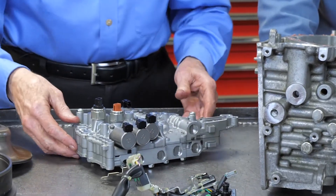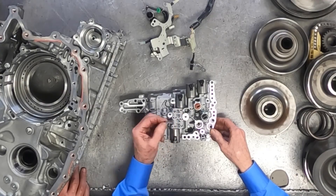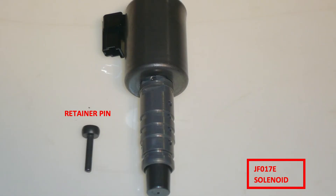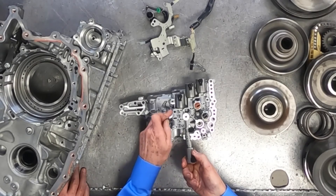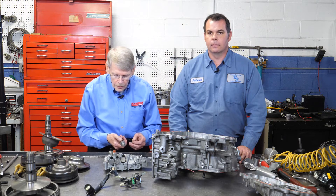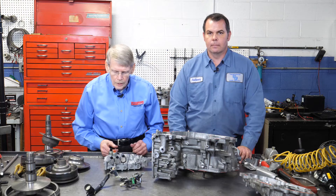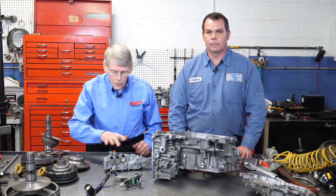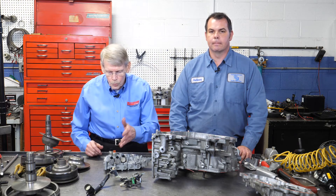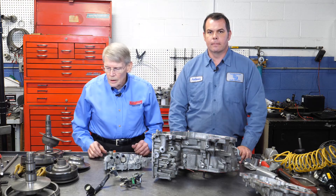You have a photo of this. Underneath the connector brackets, there are four pins to engage the solenoids. These are linear-type solenoids — all four are the same, but before taking them off, always mark each solenoid to its bore to make sure you don't get them mixed up in case there's a calibration difference. As far as the valve body itself, you split it — there are normal check balls, screens, and regular items you'd see on any transmission. Solenoid operation is certainly different than on a step-type transmission, but you do the normal diagnostics to determine if one is bad or if it's the pressure switches.